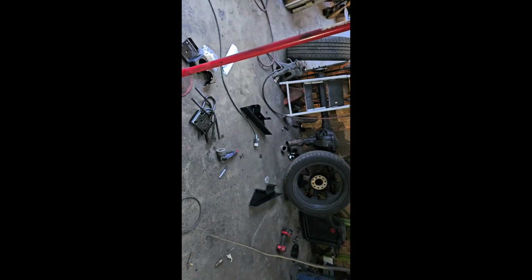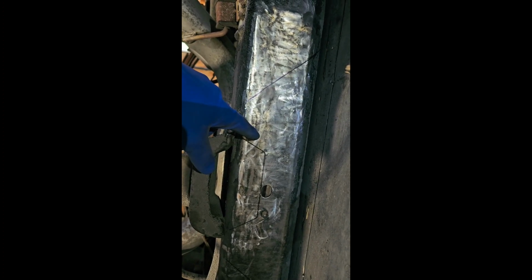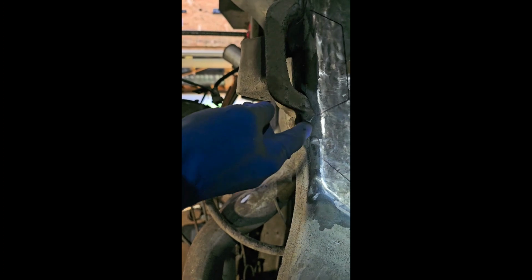Anyway, we took them plates right there on the ground and put it in the position it belongs in. Can you see the marker? All right. Long story short, though, we ain't cutting that. The only things we're going to cut is a slice here and up and follow this line. And I'm actually going to stay on the inside of this line about 1/4 inch. And why I do that, because this is marked on the other side of the metal. So compensate at least a 1/4 inch. Give yourself maybe an 1/8 inch or so around. And then same deal. We're going to cut right here.